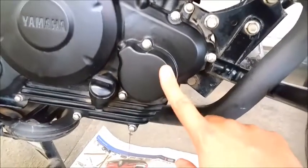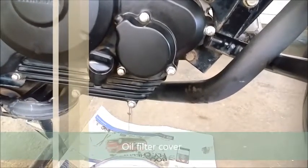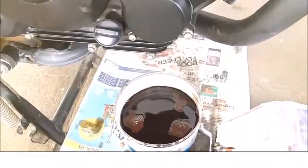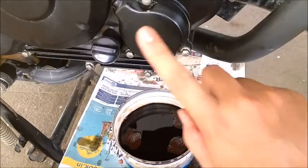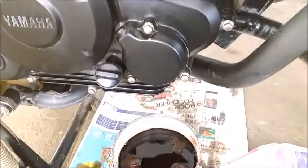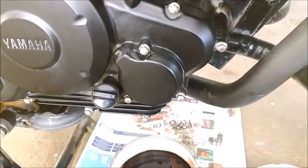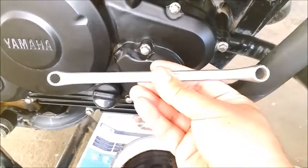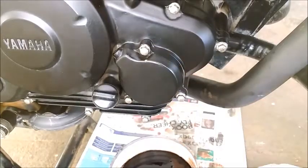Once we're done with this, the next step is opening the oil filter. I'll wait a bit and fast-forward the video to where we start opening it. You can see it's just dripping now, so the major oil has already flowed out. I can go ahead and start removing the filter — it will be quite messy as oil flows again. We need an 8/9 ring spanner for this part.